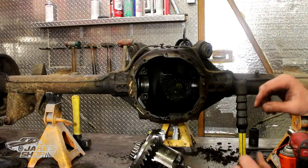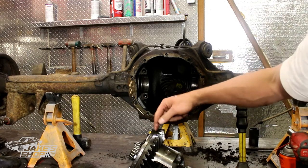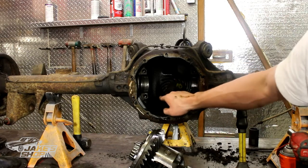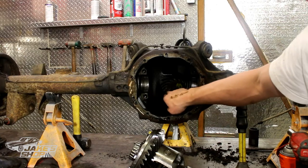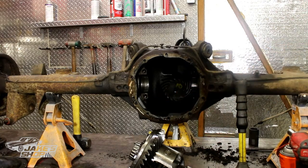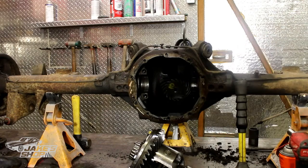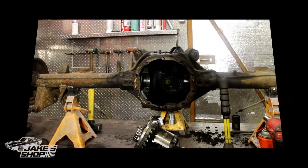Here's your big old pinion — it has a stamp in here. It says 16/41, which is the pinion for that ring. Now taking the pinion off — I'll flip it around and show you what I'm going to do to take that off. This is the pinion yoke. I've got a new yoke going on this one — a brand new forged pinion yoke from Yukon, so that thing will be bulletproof. This is going to be garbage.